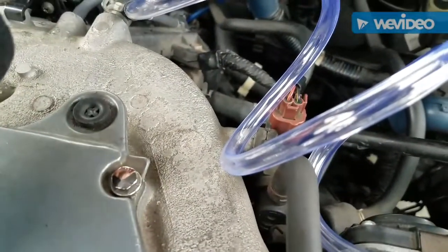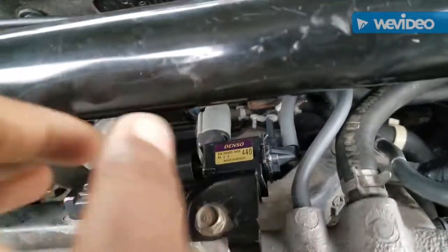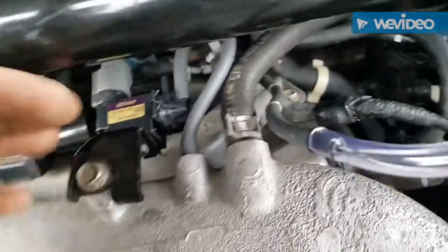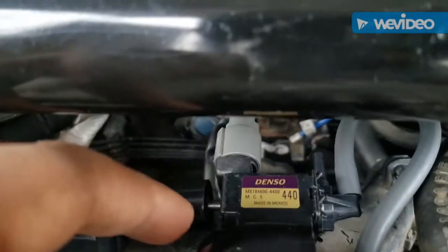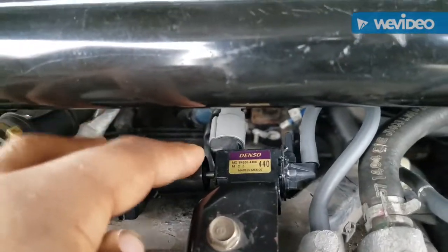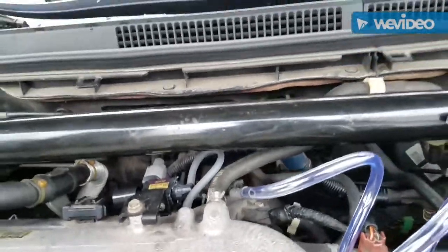The vac system is good. If you have any questions, feel free to ask — don't forget to like and subscribe. This is the mount control solenoid, which gives the mounts suction to get rid of vibration in the car, making it idle better and making the mounts harder when you drive. If this cap ever came off, replace it — it's only about $25 from the dealer — because it won't hold enough vacuum without it.